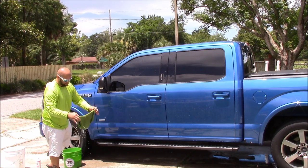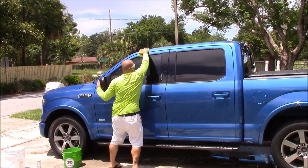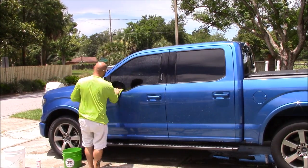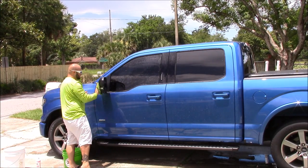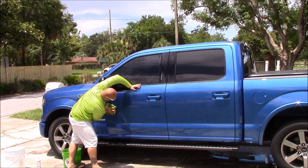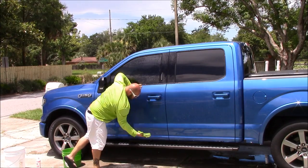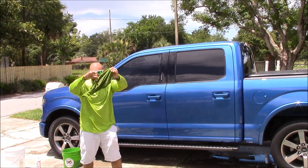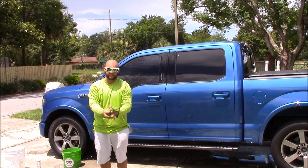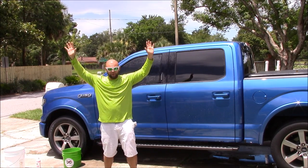That's how you would traditionally wash a vehicle with the Gary Dean wash method traditional method. We'll just do it again — take a pre-soaked towel out of the bucket, top to bottom. You never want to over-rub because you're just potentially scratching the paint. I like to go over everything very thoroughly from top to bottom. And that's it — this towel that just came off the paint will never see that paint again until it gets washed. Wring it out, discard it, and you're done. Keep pulling clean towels out.